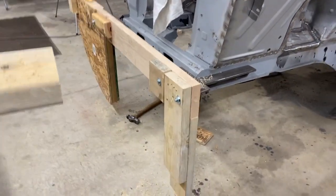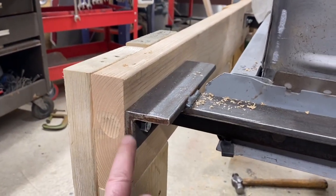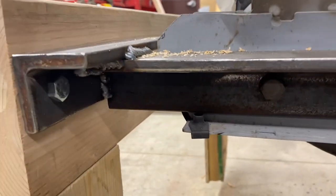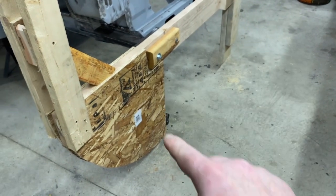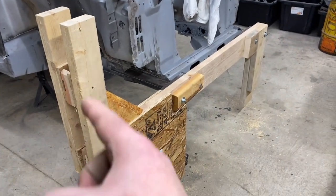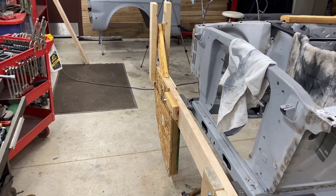Here's a sneak peek at what we're doing. You'll see one leg on this side attached to a piece — I don't know if it's a quarter or five-sixteenths, it was the thickest I could find at the scrapyard — piece of angle iron welded in a T, mounted to the two mounting holes for the front bumper, and then these bolt through into a two by six which runs the length. Here's one leg that goes down to hold the front of the Mustang, the second leg goes down right there, and then there's a curved spot and a funky leg that sticks up, which will become apparent in a little while. We need to fabricate the same thing for the back, which we're working on right now. Stay tuned.